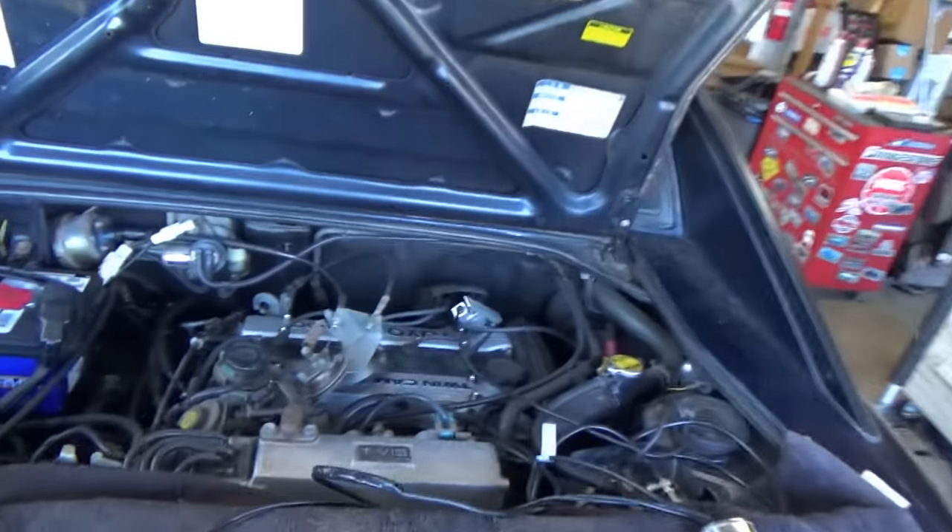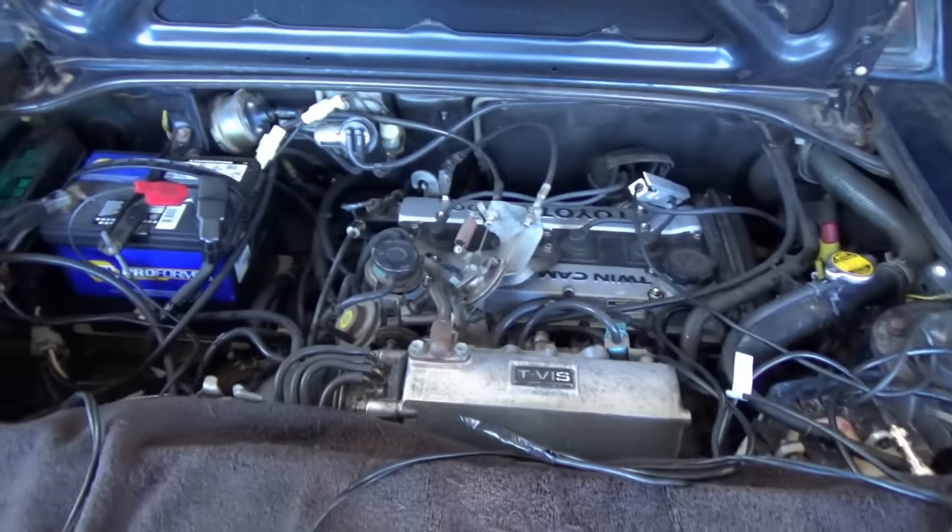On a modern car your fuel trims might jack up through the roof but the car will stay running. Here I don't think it has that capability. On the oxygen sensor, we saw it was running just flat line lean until you raised the RPM up and then it went into closed loop and started oscillating. But at idle it runs lean. As the engine warms up and the idle drops, vacuum leaks become even more critical. So doing a visual inspection - ton of vacuum hoses - let's go for the big fish.